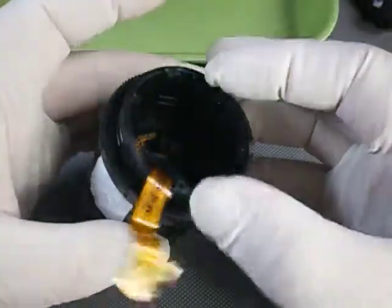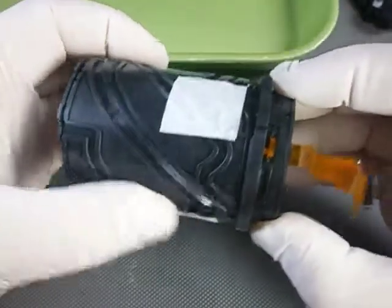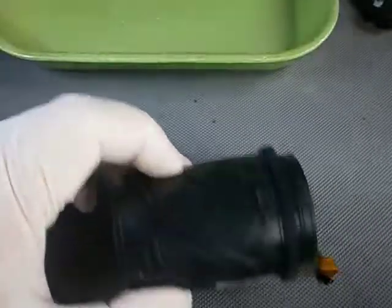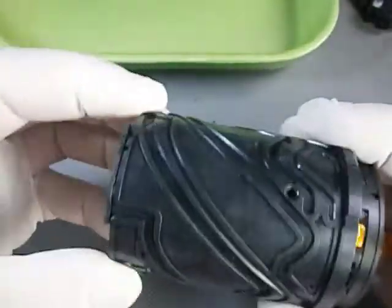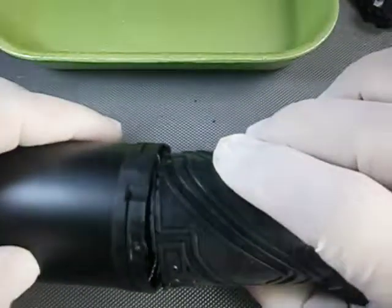And there we are. You need to follow exactly that order if you want to reassemble the lens, and obviously the reverse order to dismantle it. Now we do not need these pieces of masking tape anymore, because the plastic ring limits the excursion of the barrel cam, thus preventing it from exposing the pins through the holes. Now we are ready to reinstall the first element.